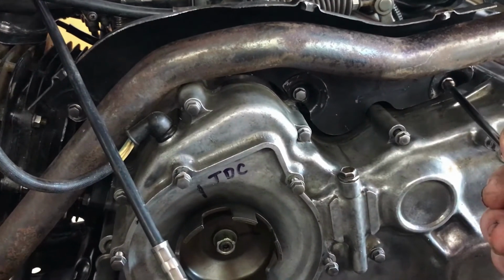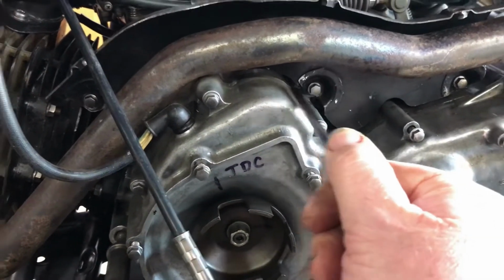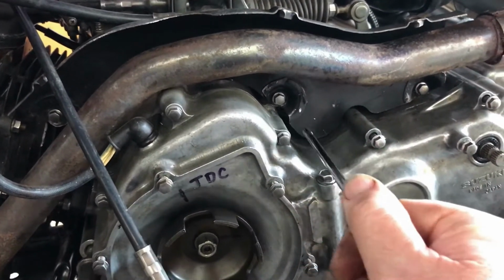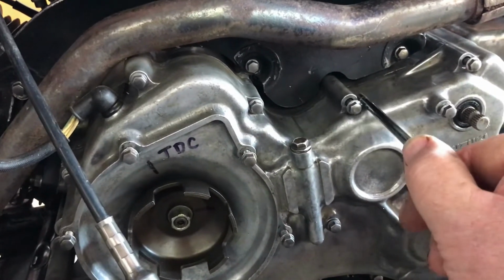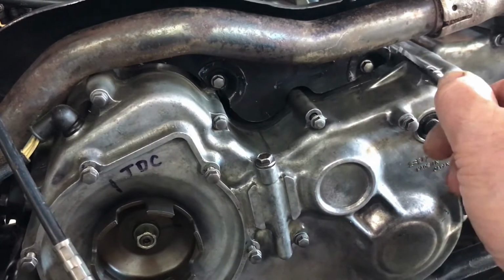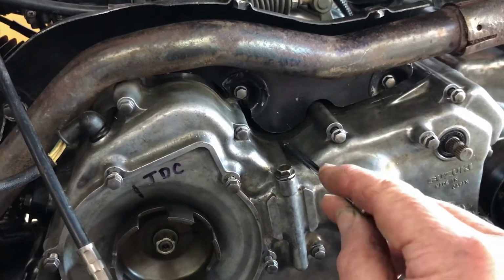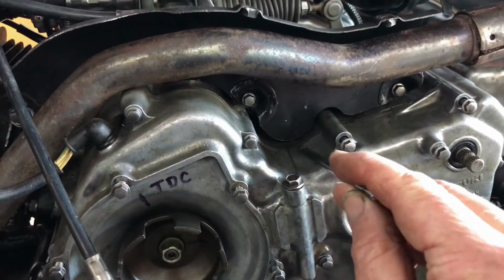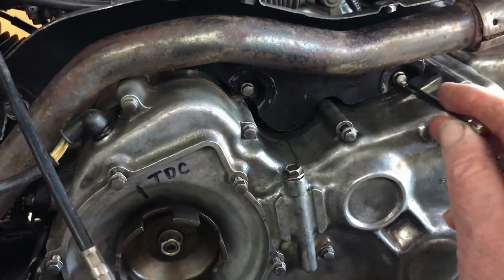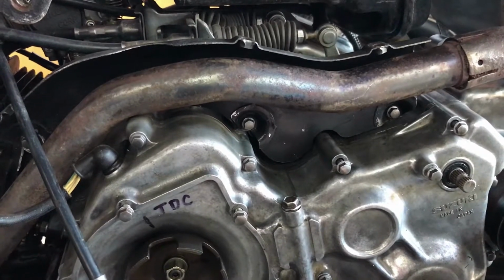That the 88-89 engine did not have the bosses here for those two screws at all. When I talk about a boss, a thing like this in behind there that that screw can go into, there is nothing there in that space at all, there or there. This is the 94 casting for the engine with 88-89 guts in it, but this is the casting of the 94. It did have those points, and this shield came off the 94 bike.